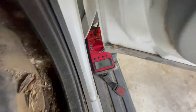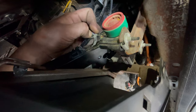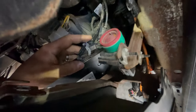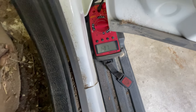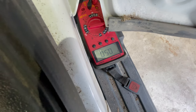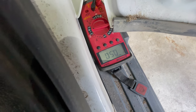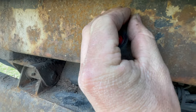I've already done the 40-minute wait time to confirm the drain doesn't go away on its own — it doesn't. Going back to the APIM: we're going to disconnect the connector and watch what happens to the amp meter. See it starting to drop? Eventually it'll drop all the way down to 10 milliamps once all the modules go to sleep. And the dead giveaway confirming the problem: the clearance light is no longer on.